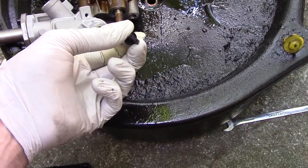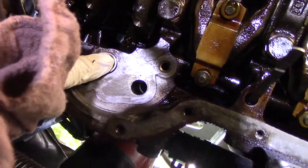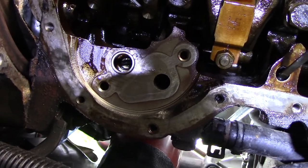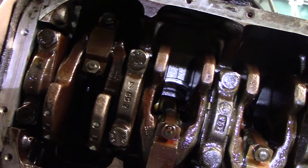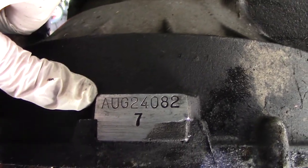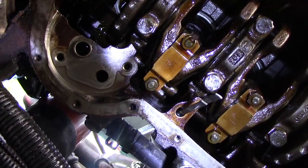The way these pumps are driven, there's a tang on the end of the shaft. Up inside the hole where the pump bolts to on the bottom of the block is the bottom of the distributor, driven by this jackshaft up there, and that's what drives the oil pump. So we'll have to get that lined up. And there's the bottom of the engine — I've tugged on all the rod bolts and everything seems alright. Of course there were no weird sounds; I just didn't like the fact that there was basically no oil pressure. One thing about these VW transmissions is the model number on this little pad on the bottom. The code AUG does not mean it was made in August — that is the model code. Just a regular five-speed trans. So we'll get the new pump up in there and get it tightened down.